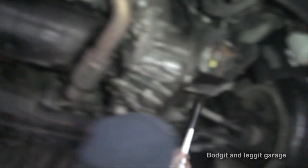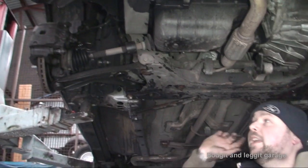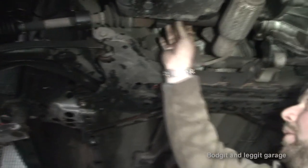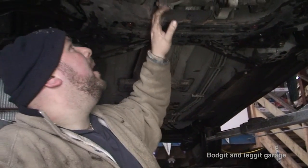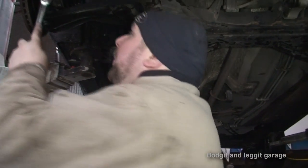This is a little bracket that comes out — these are two little bolts. This car has what you call equal length drive shafts, so basically the drive shafts are the same length. On some of the little cars this is just a big long bar all the way down to the end. Equal length drive shafts are supposed to help with torque steer. So all I'm going to do now is push this to the side now it's loose. I'm going to undo this and hopefully I should have enough to get out of the gearbox — it's maybe in the gearbox two, two and a half inches, so I only need to get it out of the way. The only problem I can see is the exhaust might be in the way.